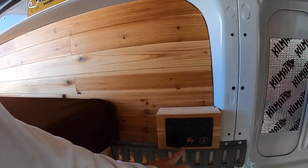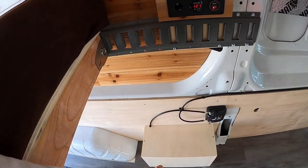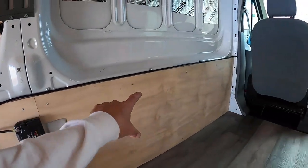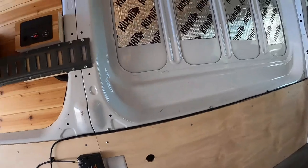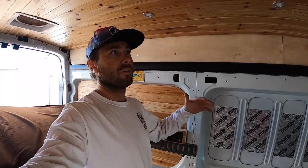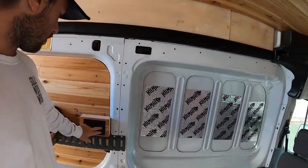I have it all wired up to a little DC panel, into a 100 amp hour battery down below, which is being charged by a dual battery isolator that runs right into the starter battery. Pretty simple setup — something easy to do instead of going straight to solar if you don't have a roof rack or don't want to spend that much money yet.